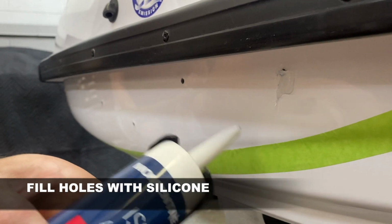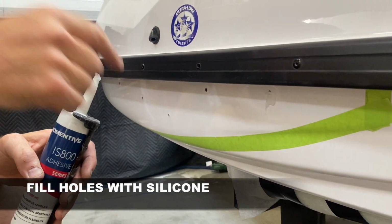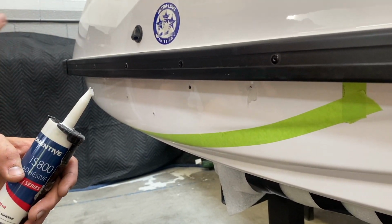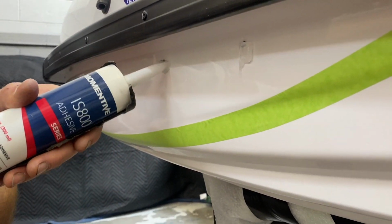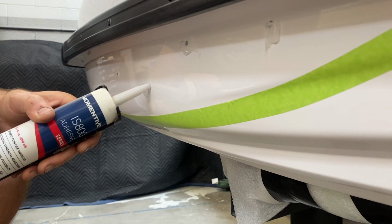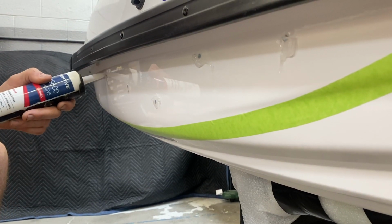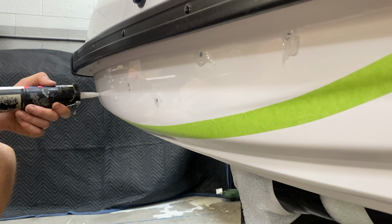You just want the screw to go in and the silicone to follow through. Sometimes the silicone lays on the tip of the screw, so if your hand's in there, you get a little protection from the abrasiveness of the screw. It also helps it bite a little bit better, as far as the screw not coming loose. Follow these steps and you're pretty much guaranteed to have a sponson that's going to stay there the life of the ski.